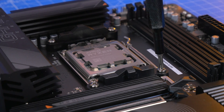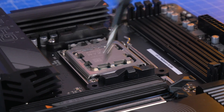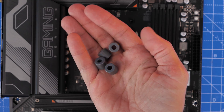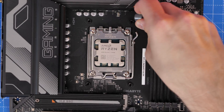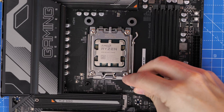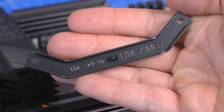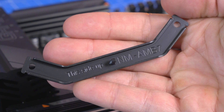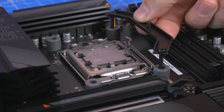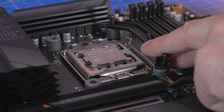For the installation you need to first remove the standard bracketing from the AM5 motherboard — unscrew the brackets and pop them out of the way because we don't need those. Then you need these grey washers which will sit down over the standoffs that come through the motherboard from the rear back plate, placing those in the four corners. If you're using the standard bracketing you'll use the MAB7 bracket — it's marked 'this side up' so you can see which way it goes — and you'll need the long screws to secure that back into place, pushing down through the washers and screwing into the standoffs on the motherboard.